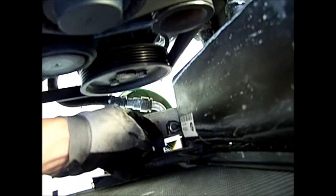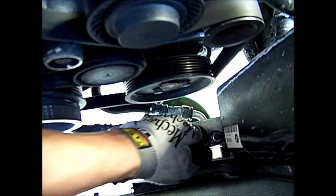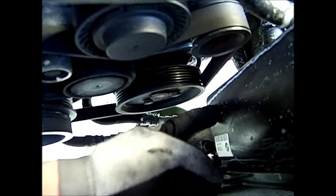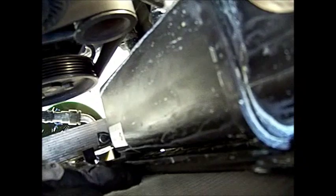Then on the driver's side, there's this unit from the transmission. You need to lift up on this release here, and there's another release here for the expansion tank — so those two need to be released. This will pull away and then you can see this bracket that we're going to be replacing — the entire bracket as well as the expansion tank. There's also an electrical connection on the bottom of the expansion tank that you have to release.